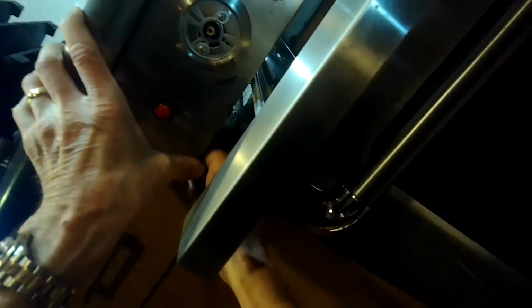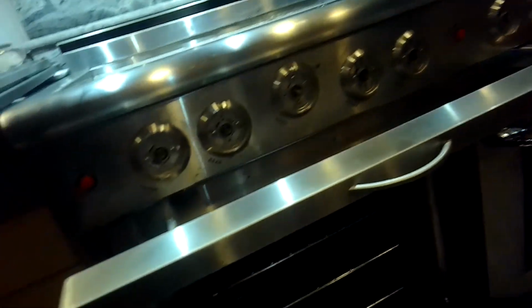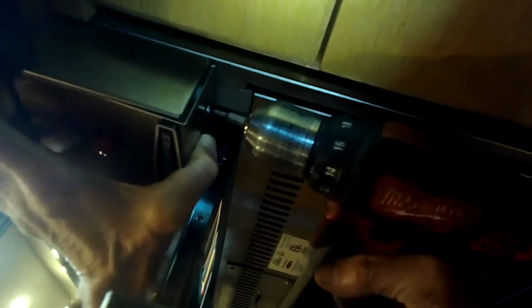And I got the box back into position. I'm adding those two machine head screws back in. The way I get the box back in is I came in at the top at 45 degrees to get it underneath the lip, and then I push the bottom in. I'm adding those screws back in. So here's that big machine screw on the right side. Let's line it up. So lift it a little bit and then zip it in. Perfect.